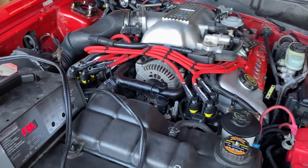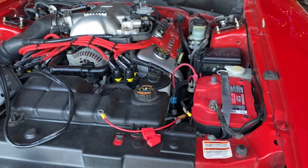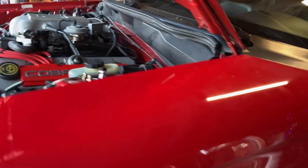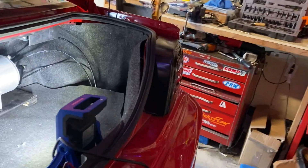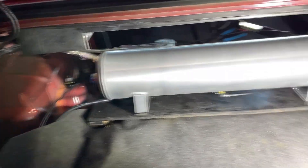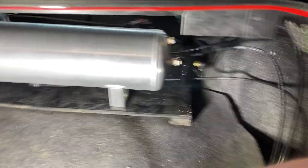Got the electrical pulled to the front of the car, just getting ready to hook all that up. We've tucked everything up and snugged up the tie-wraps. All the airlines are hooked up. The controller is down there — she's ready to go. Everything we've got set up is temporary, which is what they recommend when you put the system in. Make sure you got everything nice and loose, and then you can tie it up and make it pretty later. There's my lines coming up through the grommets. We'll cut the carpet around it to make it nice — maybe put a loom on it, clean her up.